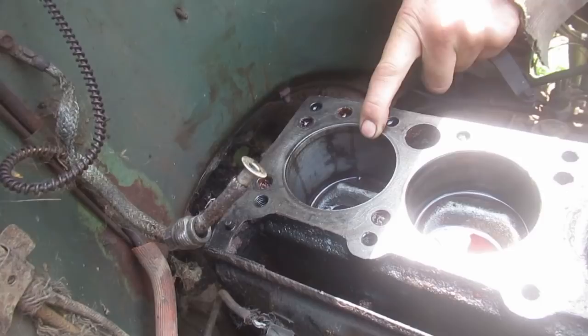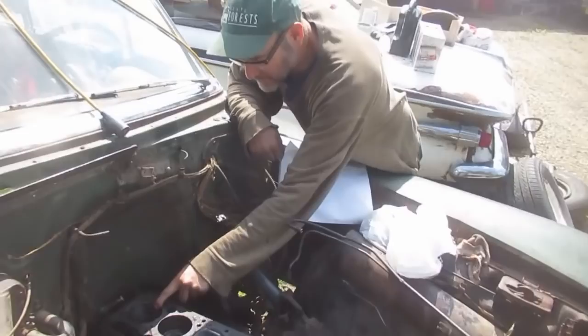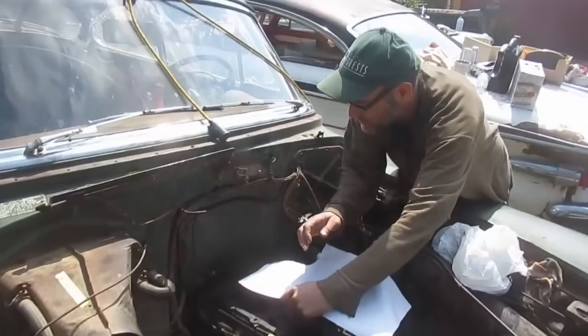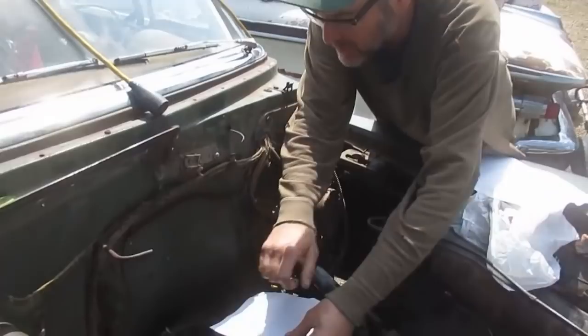We'll probably do the hot oil treatment a couple of times ahead of time, maybe to kind of thermal shock the system here. And then we'll just put a fitting on there and we'll put hydraulic pressure to it. My guess is that it's going to take at least 2,500 PSI to break this loose, so we've got to really make something tough here.